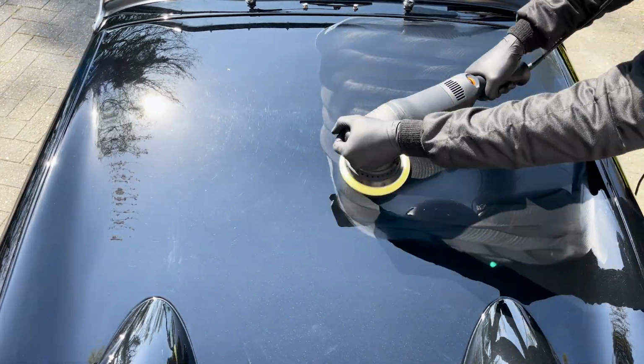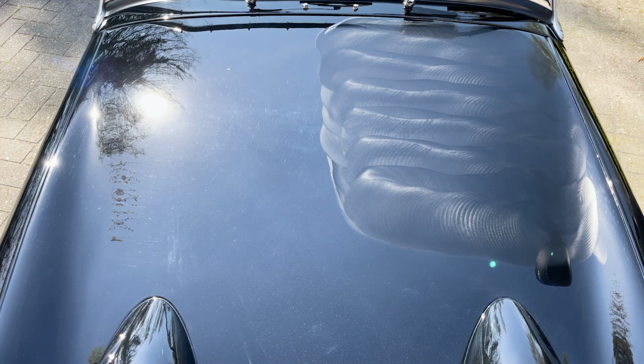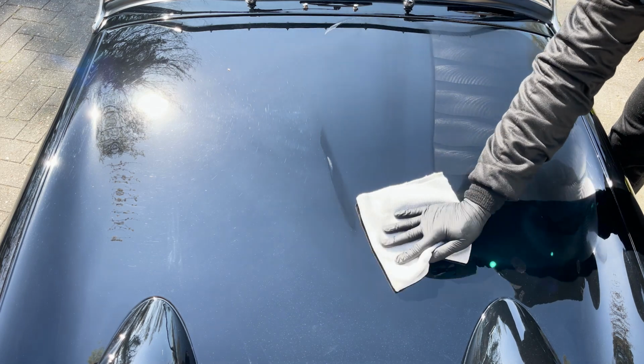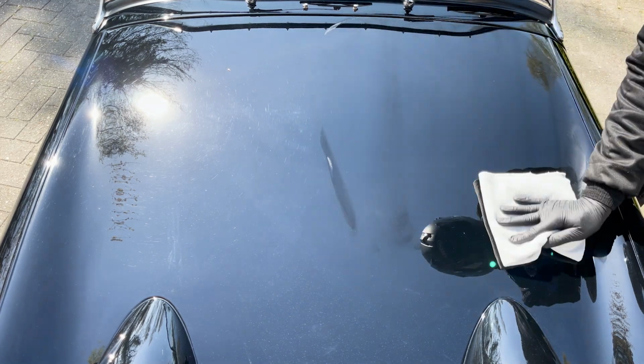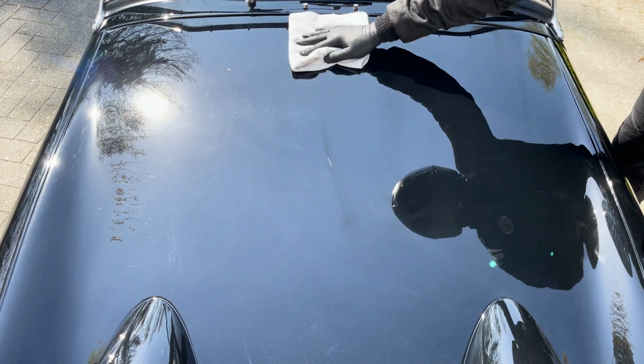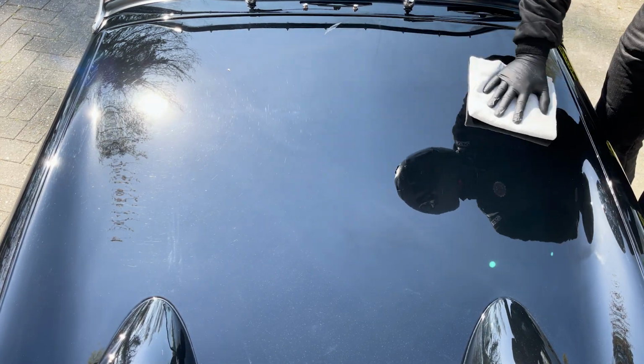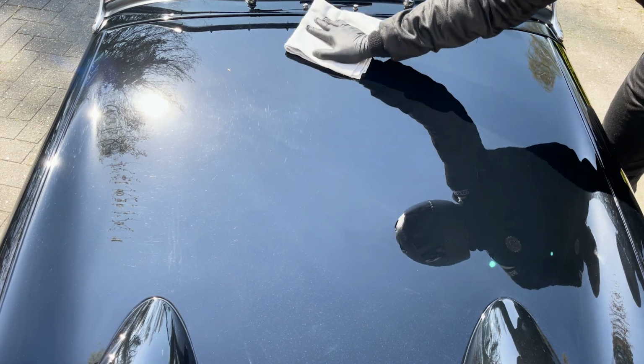We highly recommend using a special high-quality pearl weave towel to wipe off the polish residue. If your towel is just slightly rough, it might cause tiny scratches that will show in direct sunlight. You want to flip your towel to a fresh side frequently. Always wipe in straight lines from side to side and up and down to minimize visible scratches.